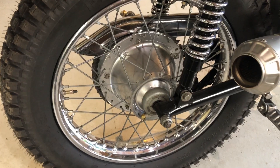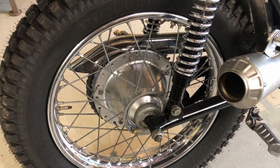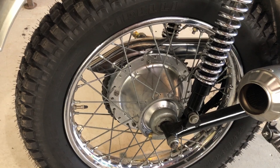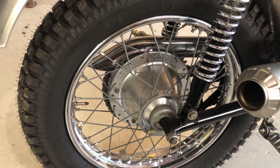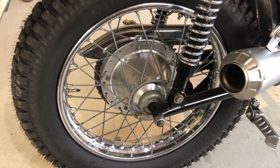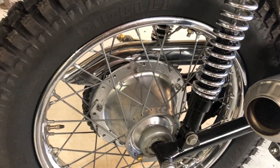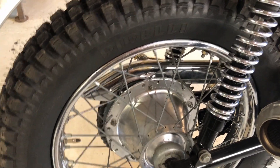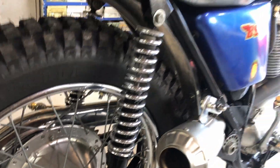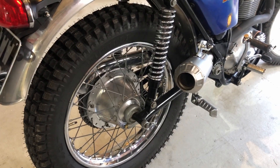There were a couple of broken spokes on the back but the rim was true and the rest of the spokes were good, so I took them all out, cleaned all the threads, got a couple of new spokes and rebuilt it - obviously new bearings in there as well. Pirelli MT-43 18 by 4 on the back, and I've also put a tyre clamp in there to stop spinning because there's plenty of torque on this bike.